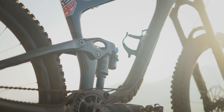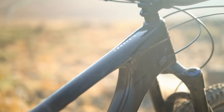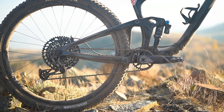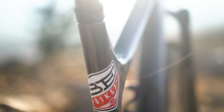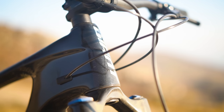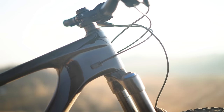I rode an extra large. I'm 6'2" and almost always ride XL. In this bike, I don't think I could go any bigger. If the extra large was five millimeters longer, I think I'd have to jump down to a large. The reach in the extra large is 510 millimeters in the low mode and 519 millimeters in the high mode, which is just super, super long. But with that really steep seat tube, it doesn't feel too long sitting down and pedaling. The steeper head tube kind of tucks that front wheel back just a little bit, which helps keep that wheelbase under control.